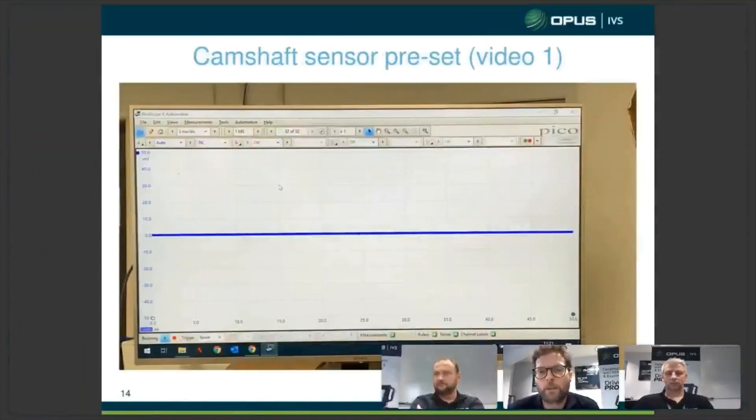As you can see, it even showed you a brief description and an illustration of how a hall chip works. The Pico software is really good in that respect, and it works for many sensors across many different cars. The library of guided functions and guided test plans is really quite extensive, certainly for the automotive software. In the next video, we're still on the same car testing the same component — we're going to start the engine and start recording and capturing data. Notice the actual data moving as the engine starts. We'll also pan across to show the same test results you'd see on a multimeter, so you can see a visual representation of our hall pattern versus just a voltage fluctuating, from which you'd never be able to tell if that hall sender is giving out a good signal.